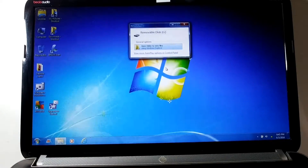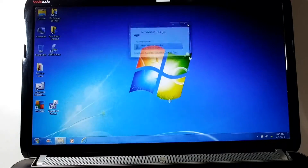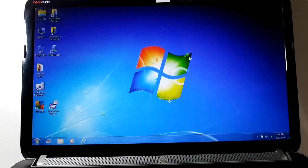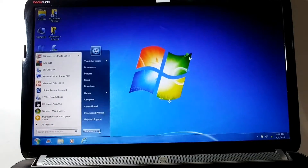Now here's the thing: you have to make sure your computer is actually bootable from the USB stick, and you can do that in the system BIOS. That's a lot easier to do on Windows 7 machines. On Windows 8 and especially Windows 10 machines it's a little harder, so you're going to have to do a little research on how to get into your system BIOS on your specific machine. There's also a website called Linux on Laptops that tells you which laptops work best with Linux.